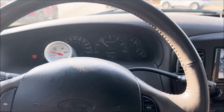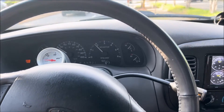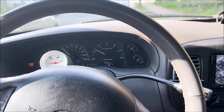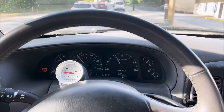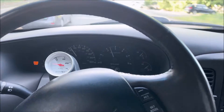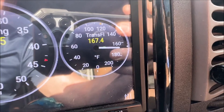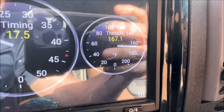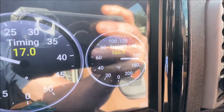Unfortunately, a test drive after replacing the shift solenoids showed no change. It's staying in second right now — it will not shift. You can see high RPM, no third gear — let off the gas, it does a little bit of shifting but it's bad. There's something wrong here. I need to pull it into second to get up this hill without letting the transmission slip too much and get the transmission temperature up too high. You can see the transmission temperature is climbing a little bit higher than normal, so I've got to be cautious. I'm going to replace the torque converter anyway, but I don't want to burn anything else up in there.